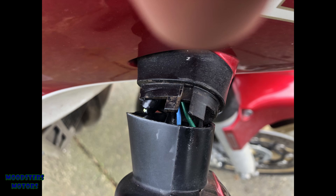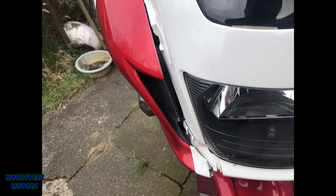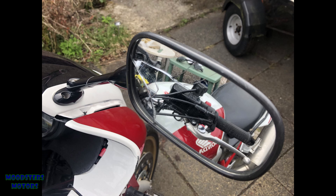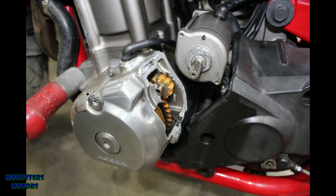This is the bike as it was received off the truck when delivered. As you can see there are various scuff marks, damage to the handlebars, damage to the screen, damage to the fairing. There are chip marks out of the paintwork. The fairing mount seems to be twisted. The radiator is bent and twisted and crushed against the exhaust pipe. There is a broken mirror as well as a broken mirror mount, and a broken indicator almost inevitably. The mirror mount to the left-hand side has sheared completely away from the bike. But the main problem is the breaking of the starter motor mount and the loss of the intermediate gear.